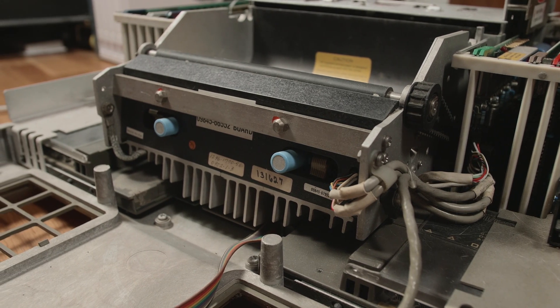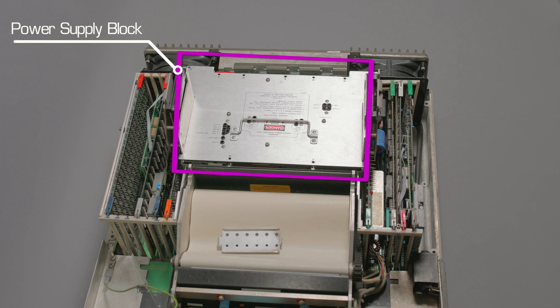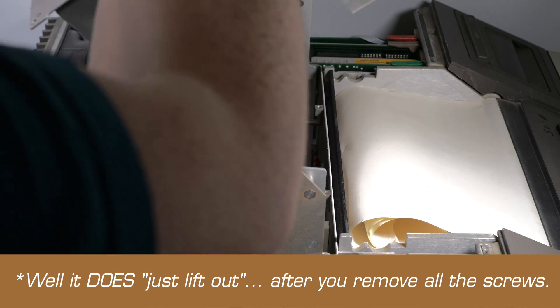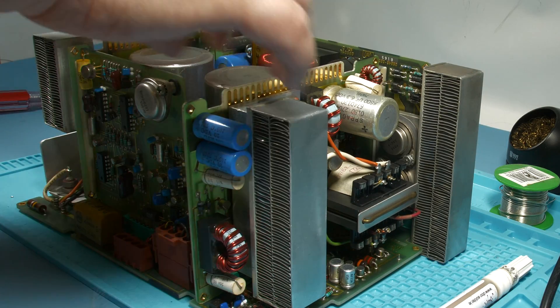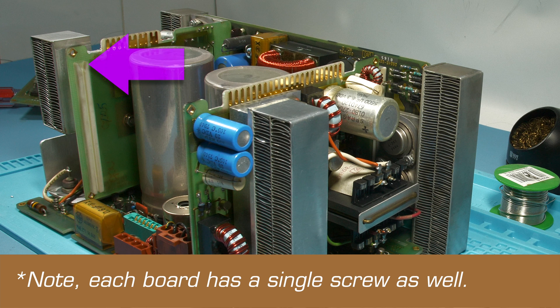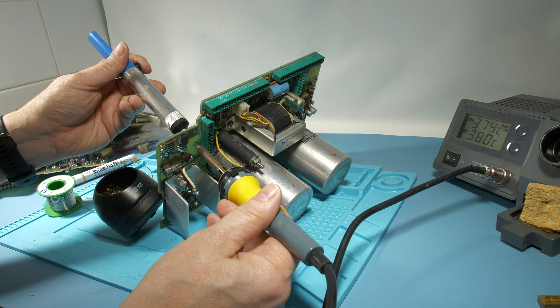Our working system soldiers on despite its age — we've not even replaced its drive belt. Next, at the center of it all, is this big metal plate. At the very heart of the machine, you have this elaborate power supply — it's like a puzzle box. It comes out of the central pocket as a kind of self-contained cube; all the cabling is on captive plugs and edge connectors, so it just lifts out. What you get is the base plate — actually the top — with four boards that structurally support each other. The two side boards are structurally fixed by their edge connectors in the base; the front and back boards ride in plastic runners. It's great, but famously painful to unpick for diagnostics. Ours has been recapped, of course.